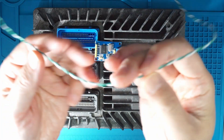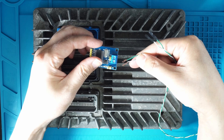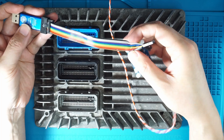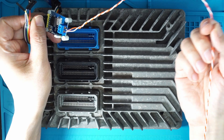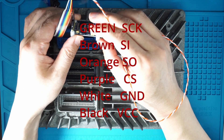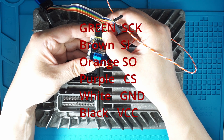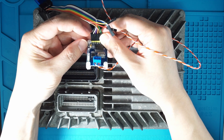You also need a wire crossbar here, with one side connecting to the CAN bus and the other side connecting to the MCP board. The SPI connections are on this side: the green wire is the clock, the brown is the SI, the orange is the SO, and the purple is the CS. The white is ground and black is 3.3V.